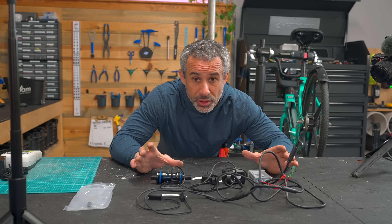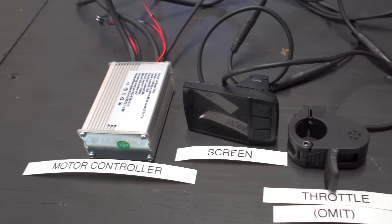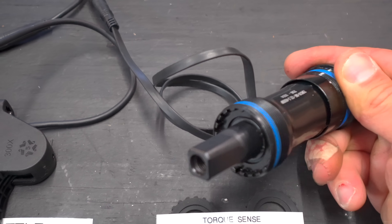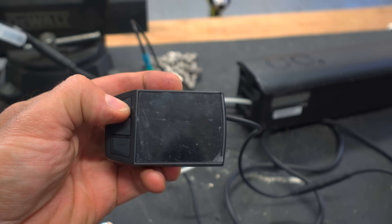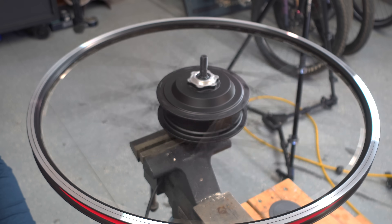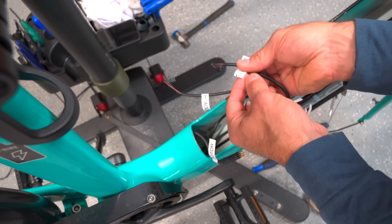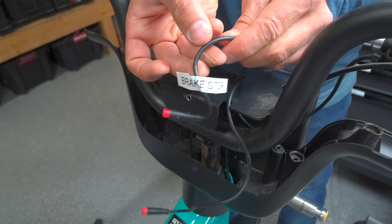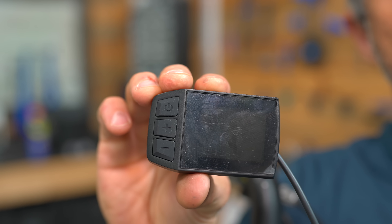Here we have the electronics that are getting installed on the bike. We're going to test it on the workbench. Here's the motor controller, the screen, the throttle, and the pedal assist sensor — which is actually torque sensing. Everything's connected to the battery we're actually using. The screen is on, we're going to just throttle test it. We're up and running — we know our electronics work. There's a fair bit of stuff we're keeping on the bike: I've labeled all that, including the brake outputs, lights, and some of the wiring. Not all of this will just plug in or fit, so let's mount the controller and tackle each item one by one.